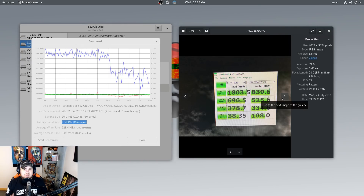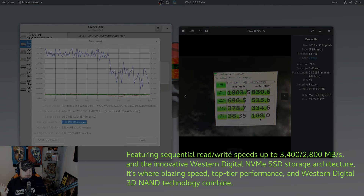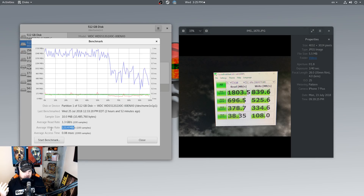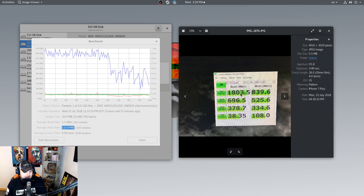Here's where things start to get funky. This is in Windows 10 — it's the same drive, still in the 2.0 slot, but using Crystal Disk Mark we're at 1.8 GB/s read. I've seen everything from 1.3 to 1.8 depending on how many times you run it. But look at these write speeds — far more impressive. At one point with the 4K test you're at 100 MB/s, but in sequential write we're showing 839 MB/s. The question is what is really going on here.